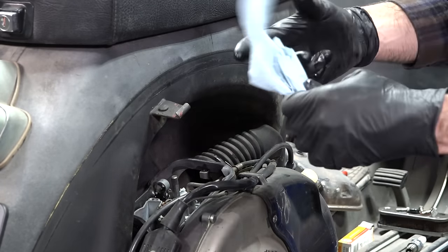I'll turn the fuel off and turn the ignition off — let the evacuation fans get rid of the smoke. Then I'll go ahead and assemble the air filter — put the air cap, the little top hat. The rubbers are all intact; we do sell a complete rubber kit for all those little pieces of the air box if any are falling apart. I'll put the mixture plug in after a test ride because I may want to make some minor adjustments.